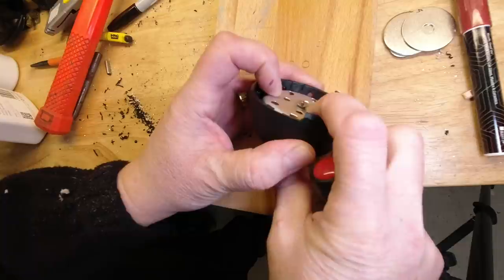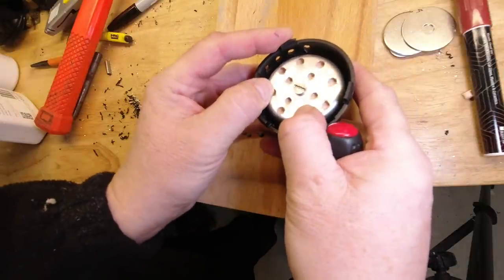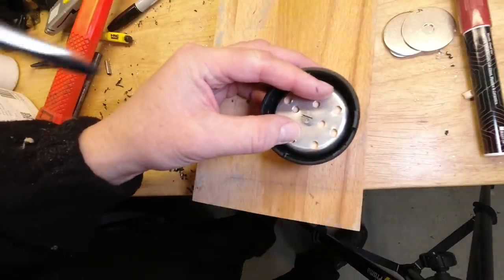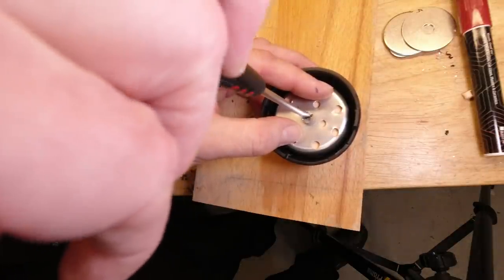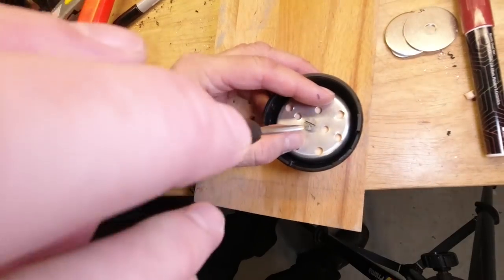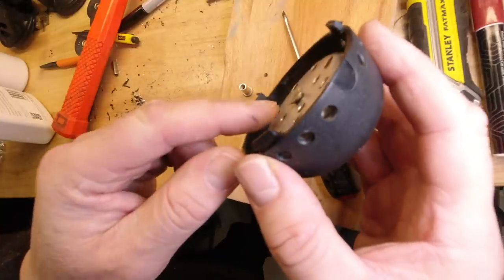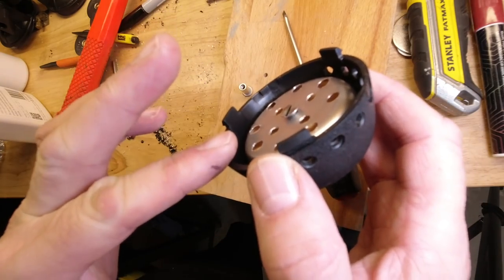Okay. Just level it off in the cone of this, because now we're just going to pull it a little bit deeper into position. That's going to make the bottom of this a little bit concave. The reason for doing that is the top of your strut stands up about 5mm proud, which is about where this is. I'm just giving a bit of clearance and squeezing it down a bit. There we are. Looks really smart. It's just distorted the panel, just a fraction, and I've got about 5mm clearance between here and here.